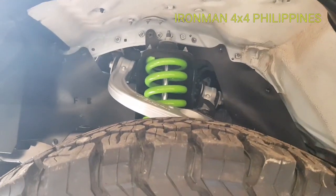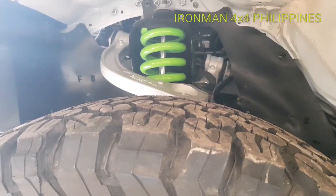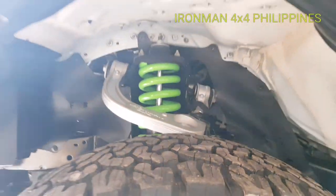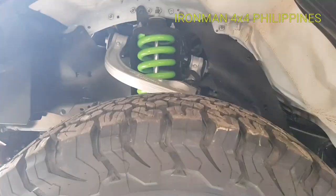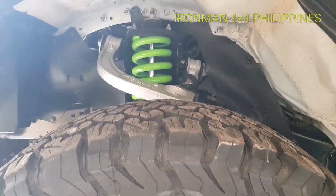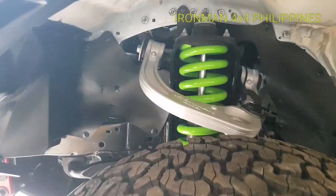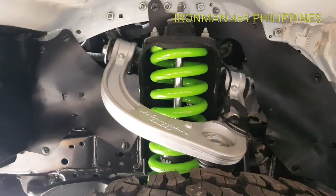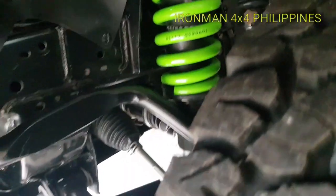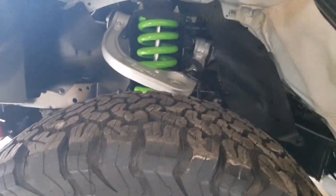The recommended droop is a minimum of 60mm, so this means we can still lift this vehicle another 10 millimeters — because now we have 70, we'll lift it about 10mm more to get 60mm of droop. I got about an additional almost 10 millimeters of droop after installing the Ironman Proforged upper arm. I'll adjust the pros — they are height adjustable — and we'll see how this looks after.